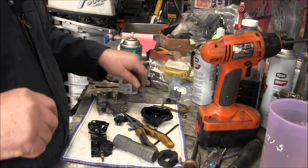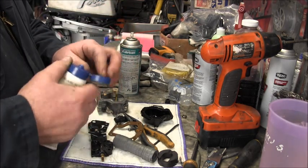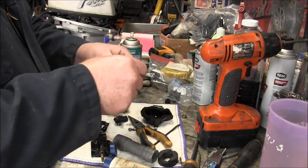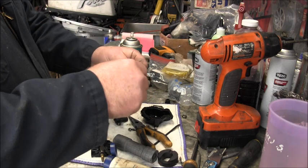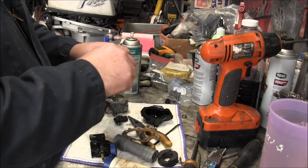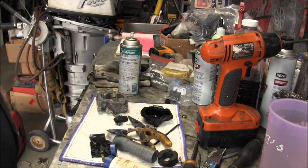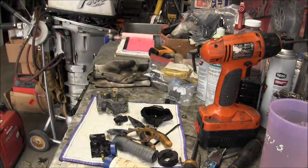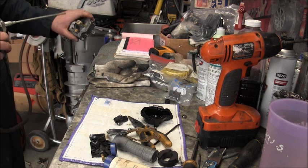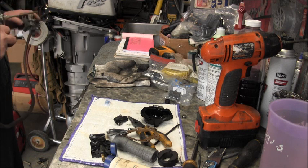All right, Vaseline. I like to put some Vaseline, some petroleum jelly on these gaskets. Keep them nice and pliable and nice and pretty and yummy. Now, after I run them through the ultrasonic cleaner, I take a little bit of lube, Tri-Flow and whatnot, squirting all the orifices. And after I do that with that, air, little burst of air here and there.